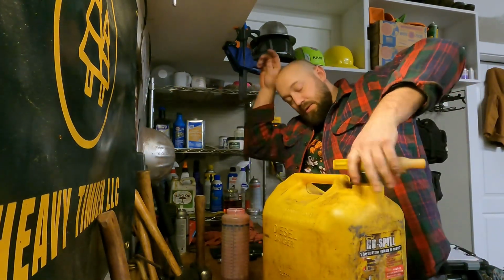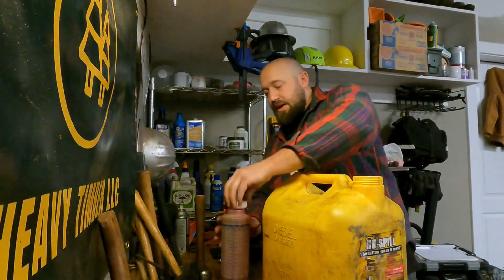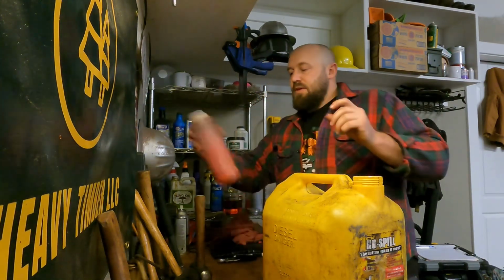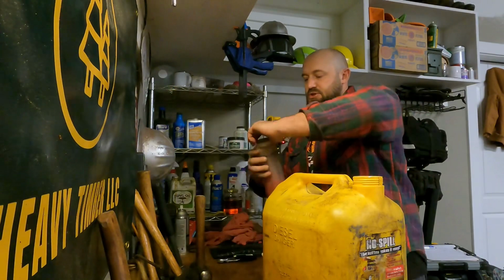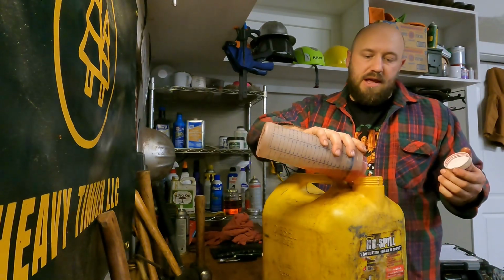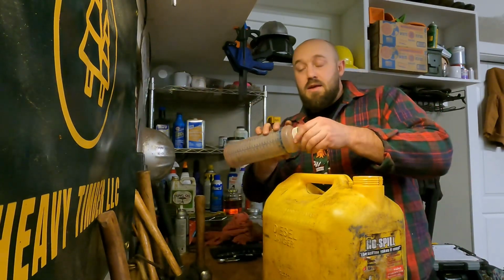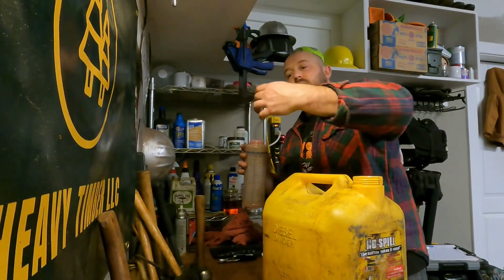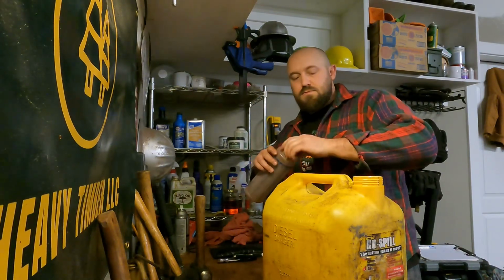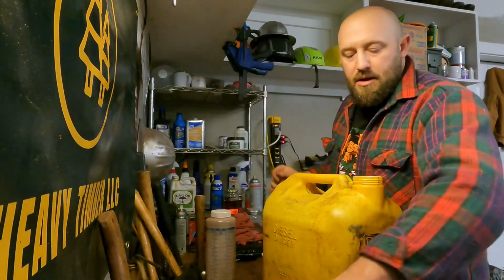Right? So that oil is soluble in the fuel, so it's a good way to get all the excess oil out, and then you guarantee you have an accurate mixture, because now you've cleaned out all the oil that was stuck to the sidewalls of your little mixer can. Is it gonna make that big of a difference? No. But if you're kind of half OCD like me, it makes a big difference to me. So got that all dirty. That's cool. If you're anything like me, put a little fuel, shake it up, pour it back in, and your mix is scientifically perfect.